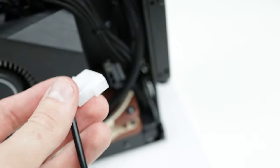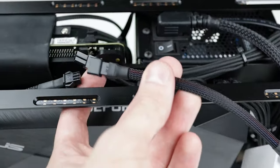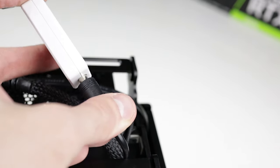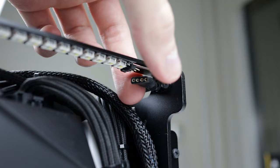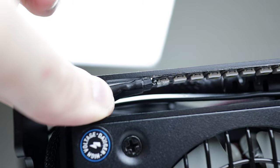So if you've got Mjölnir R, it's time to install the RGB setup. First, plug in the Molex cable from the power supply to the Molex to 5-volt adapter. Plug in one of the RGB light strips to the RGB controller. Connect the RGB controller to the 5-volt connector. I usually hide the RGB controller behind the GPU cables. Now connect both LED strips to each other. And that's it — if you do some gaming in the dark your rig will look glorious.